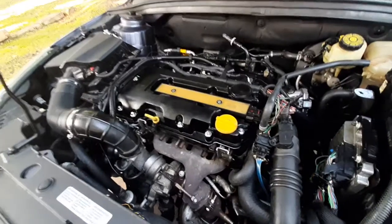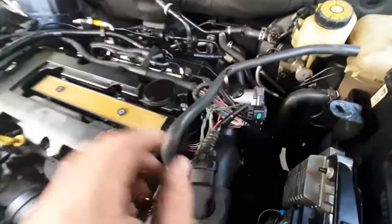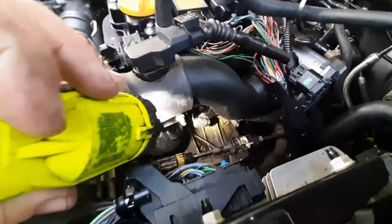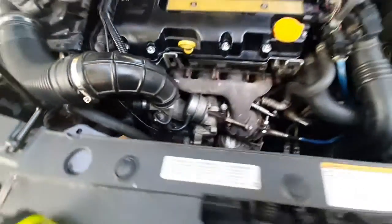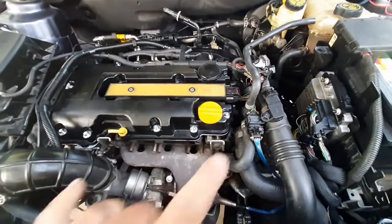You think cooling fan running all the time, you'd think engine coolant temperature — and that's a good starting point. This thing has two different sensors. There is one sensor right there where the flashlight is shining, a two-wire sensor — that is your engine coolant temperature sensor. And right down here along the side of the radiator, there's a wiring bundle that runs across the top and goes down in that hole. There's another coolant temperature sensor there, and that is the radiator coolant temperature sensor. They both have to be reading right or your fans will have trouble. They are the exact same sensor, but it does have two of them.